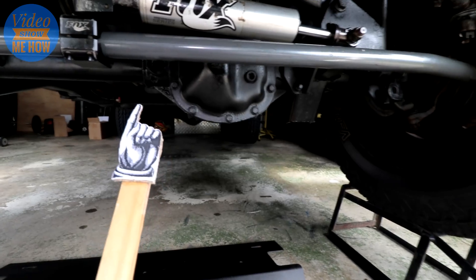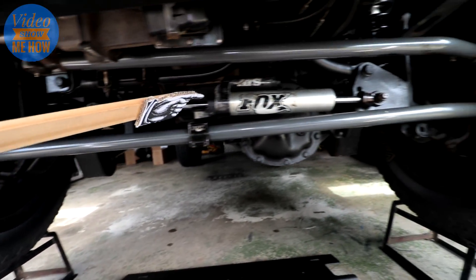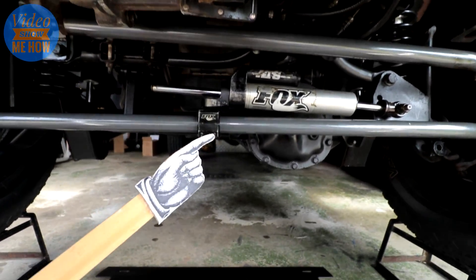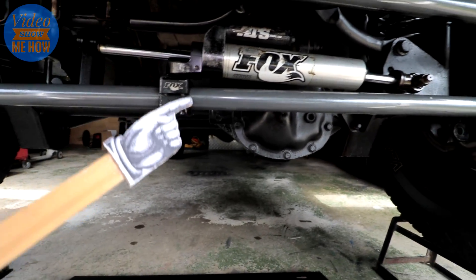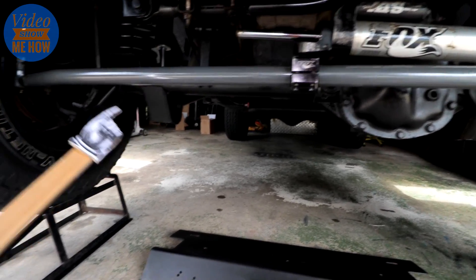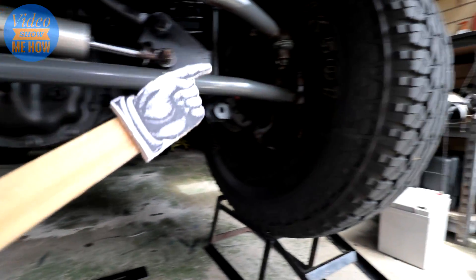Because the dampener hangs low it tends to push upwards on your tie rod itself, which can cause the thing to have a bit of a banana shape. I have in the past used it to bend it back the right way, but that lasted only a little while — once you've bent steel a few times in the same spot it tends to get quite weak quite quickly. So that is the tie rod, because it is tying your two front wheels together.